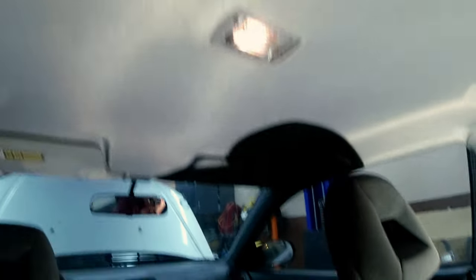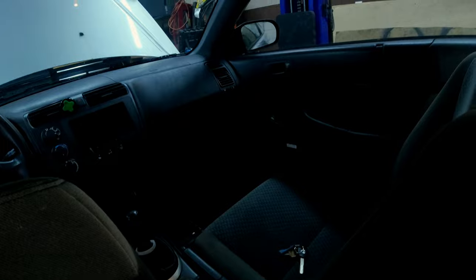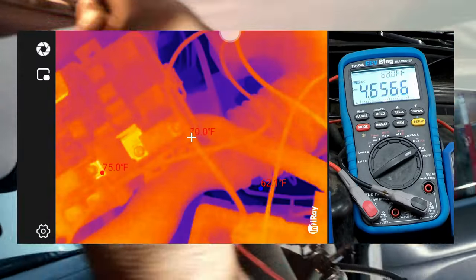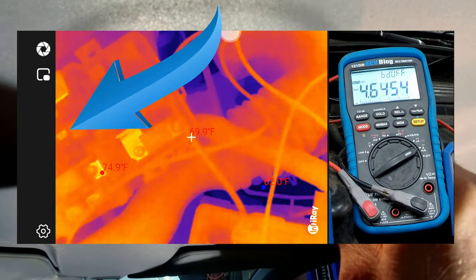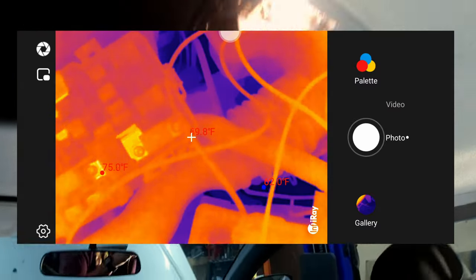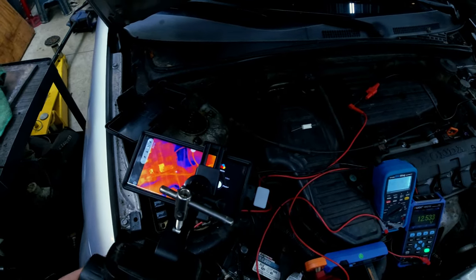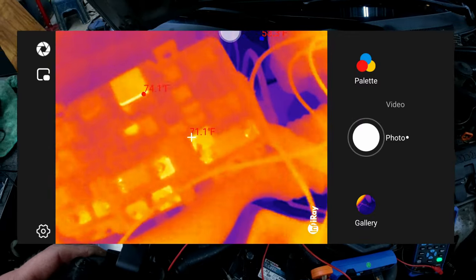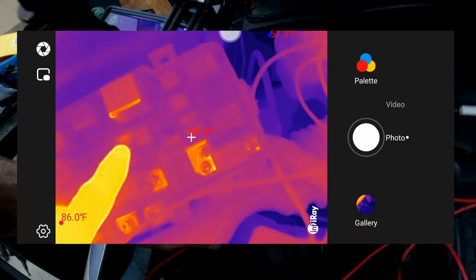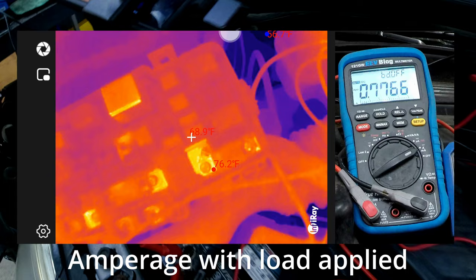The dome light is still on. I also have this light rated for four-and-a-half amps — I'm going to hook this up as well. Our light is lit, so we're pulling close to five-and-a-half amps on a seven-and-a-half amp fuse. That's some serious amperage. Coming back with the IR camera — you can actually see the fuse now. It's this little one right there, the seven-and-a-half amp fuse, actually showing up. So it took almost five-and-a-half amps to show up on the screen.